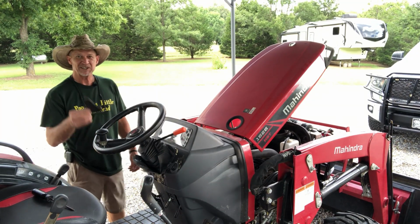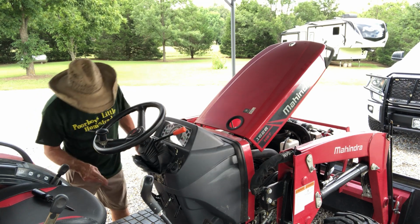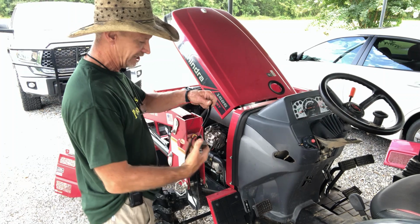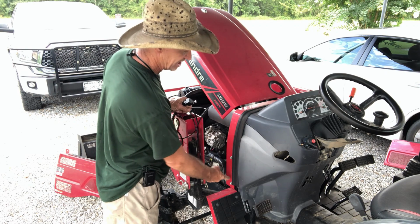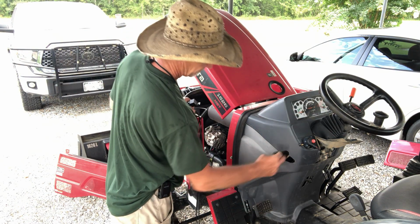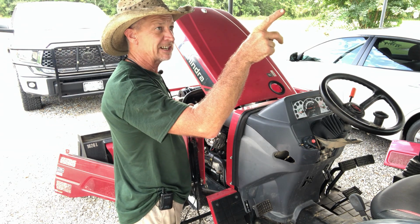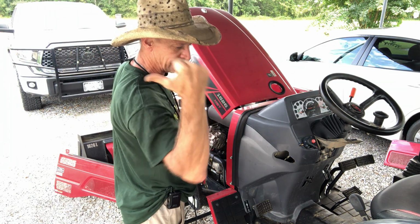Let's see, guys, this side of the tractor's got a removable deal right there. Now guys, this is what I'm saying, plans change in the middle of it. After looking, it's easier to run it on this side of the tractor because it has a little removable plug cover right here. I can run me a wire down in there and fish this wire up through there. And all I got to do is on my LED light up there, take it off, flip it over, and the wired connection will be on this end. So it'll be back on this side of the tractor.